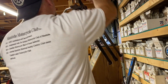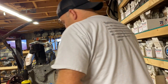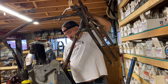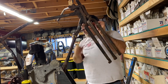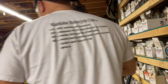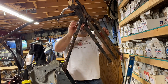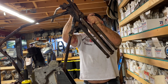Just continuously heating and cooling, adding some penetrating fluid, tapping it with a hammer to break it loose from some of the rust. There's a center point on that front fork leg - just two studs that come out - no bushing or anything, just a pivot point. The arm that goes to the back leg was really seized on there pretty good. I was able to get the top and bottom bolt off with lots of working it back and forth, but the center was really tough. I'm just punching through the bolts, going side to side, trying to loosen it up.